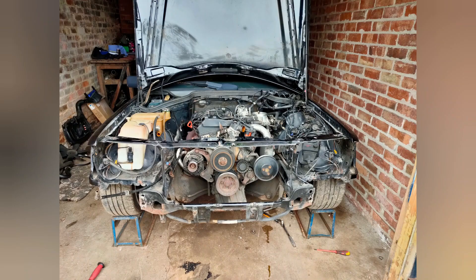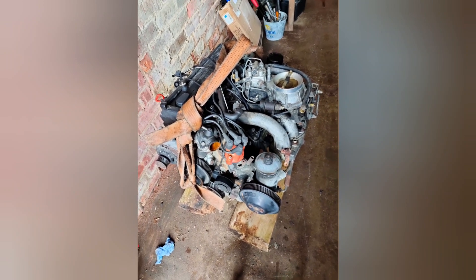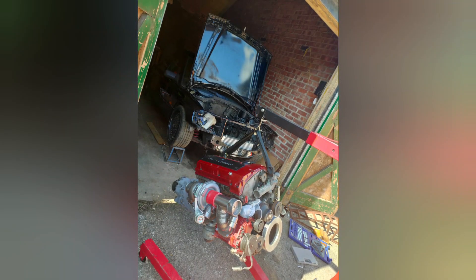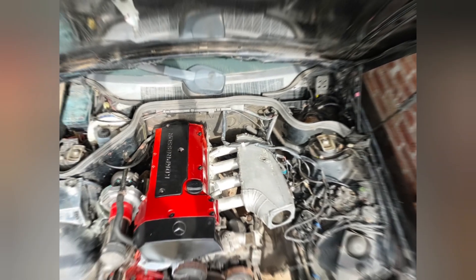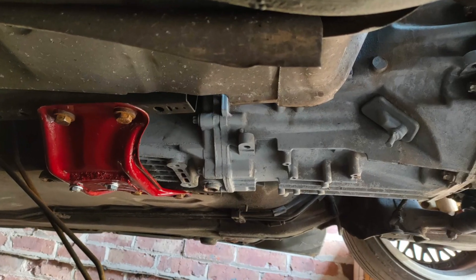So we got the 10-year-old engine come out — pretty simple takeout. Got the engine sold, and the gearbox. Got some parts: a backside intercooler, a clutch kit and single mass flywheel from Diesel Pump UK. That went in there. Then it was time to drop the engine in. There was a lot of wiggling and scuffed knuckles to get it in. I had to make a custom gearbox mount to fit the SLK gearbox, which was basically dropping the 190 mount and the SLK mount and welding them together.